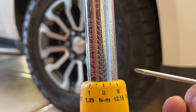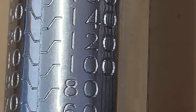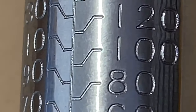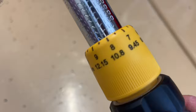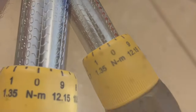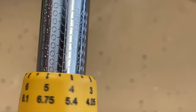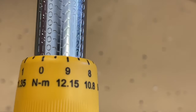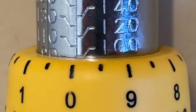As an example, let's go to the 100 foot-pound mark. You'll see the 100, and if you look at it, there's a little line that comes from the 100 and it actually drops down. The reason it drops down is so that the 100 will still be exposed when you slide it around and it's up to that level. So we're going to spin this around until it's basically covering the 90. We've spun this all the way up to the 90 — see where the 90 is, see how it drops down and our zero is on it. So now as we spin: 97, 98, 99, and 100 when we put the zero mark right there. This is what it should look like to be set to 100 foot-pounds.